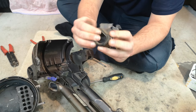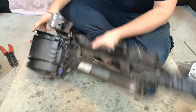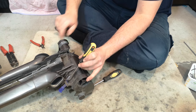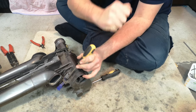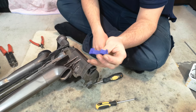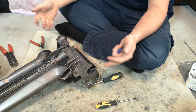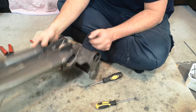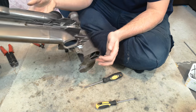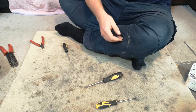So normally this seal would be taken off, but it's glued on, so we're not doing that. And then finally, something that I always do is take the screwdriver, stick it on the back of the filter clip, and eventually, there we go, it will pop out. These snap fairly frequently. Unfortunately, you have to go to roughly this effort, obviously without the wheels on, but the whole thing's got to be stripped down in order to remove the elbow and get at the back of that clip, and the chassis is done. That's all that needs to come off of there.